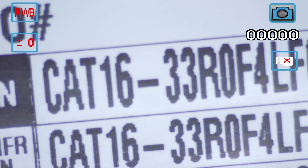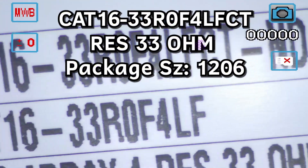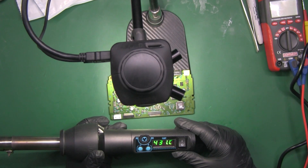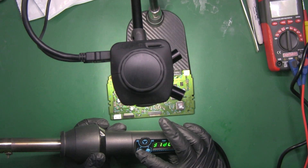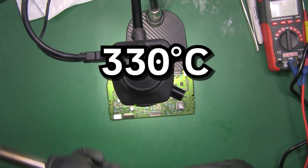I've returned with our resistor arrays. In case you need to purchase these in the future, there's a part number from Digi-Key. Since my last repair video on these Samsung drives I've learned quite a bit about resistors — not only will the one that has failed fail, but other ones of similar type will also fail. So it's best to just replace them all instead of only replacing the failed one. I've personally never seen the 82 ohm resistor arrays fail, but if I ever start seeing them fail I'll definitely start replacing them all. For now we're only going to replace the 33 ohm resistor arrays using our hot air wand.